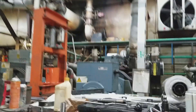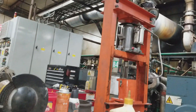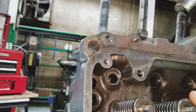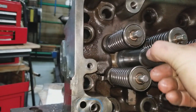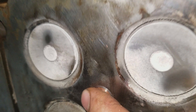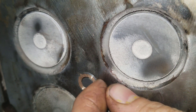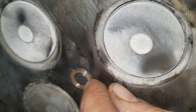Right now I'm inserting the dash 3388-0-7. What that does is perform the final verification for the depth of the injector tip. What we're looking for there is flush to eight thousandths, so you're definitely going to pull out your sled gauge. That checks out good to go.